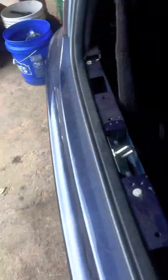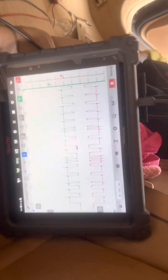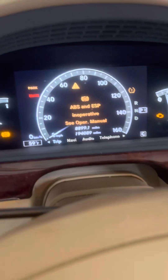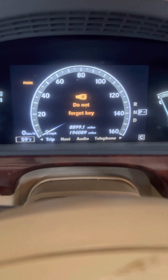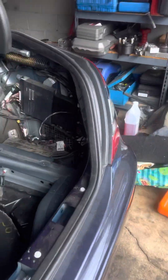Here's what I found — this is a parking aid sensor. Take a look at this: moisture. It's no good. So I'm going to disconnect it and look at that bus again. It's awake. The bus is good now — so that kind of makes sense.